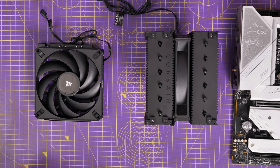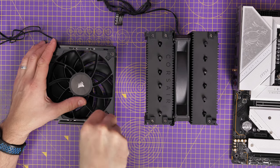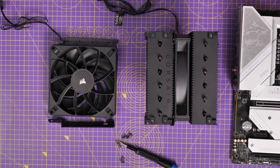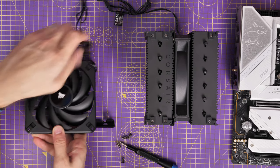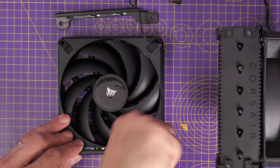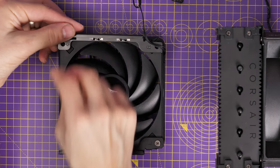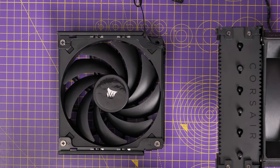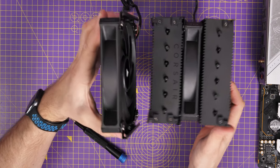As I mentioned earlier, the RGB RAM is an issue on this board. So I'm taking off the fan I added earlier, changing the bracketing around, and putting it on the other side. Instead of an intake fan pulling air from the front, it'll help exhaust air out the rear, assisting the middle fan. You need to swap the direction — the side with the Corsair logo and not the back struts is where air is pulled through. So we put the bracketing on the other way around: left on the bottom half and right on the top half.